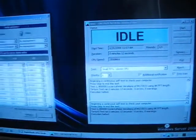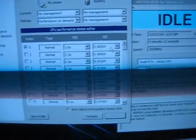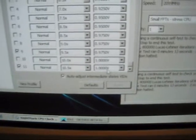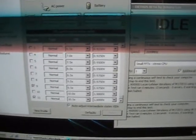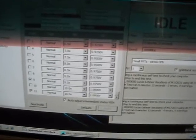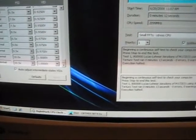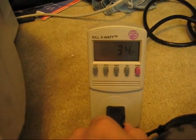I'm going to show you this program called RM Clock. What I've done here is undervolted this Athlon X2 4000. Stock voltage is 1.3V. I've set the idle voltage at the lowest multiplier to 0.9V, and the highest clock speed is at 1.00V — reducing it by quite a good measure. I've tested this through trial and error to find the voltage that will let the processor run without issues. I'm going to enable these voltage settings, and instantly we'll see that the idle watts this computer is pulling from the wall drops to 34.